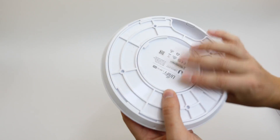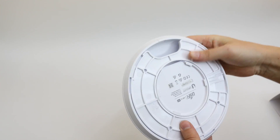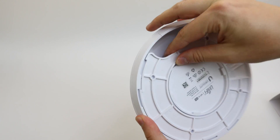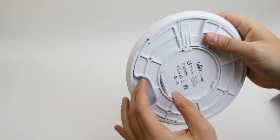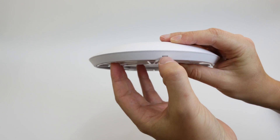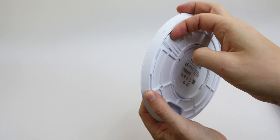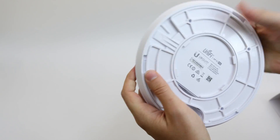I was just fiddling around with this kind of UFO-shaped access point. This ring here is the wall mount. Before you break it — see that little hole? You go in there with a screwdriver and then you can lift this nose up, and then you can open it.